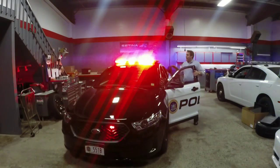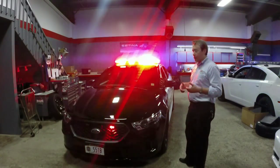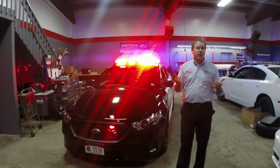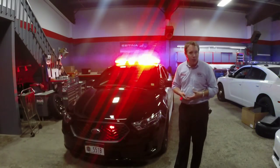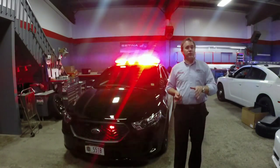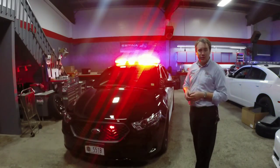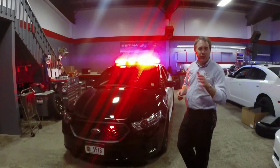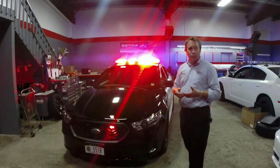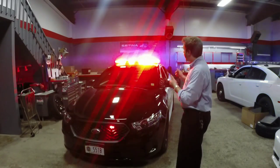You've got a chance to see what a lot of the features will do. What I've turned it over to now is what we call standby or block mode. Our customer came to us saying they'd be doing a lot of traffic details. This is a great option not only for traffic details but potentially for DWI patrol, DWI checkpoints, and stops. You can have the lights set up so that people know you're there. In some states it's required to have lights illuminated solid on the vehicle — what they call steady flash, where the lights stay on solid and then about every three to five seconds they flutter ever so slightly so you know the vehicle's there. To make your vehicle compliant with some of the upcoming changes to state regulations, that's an option for you.